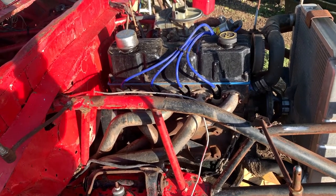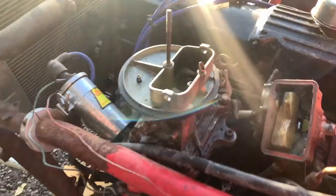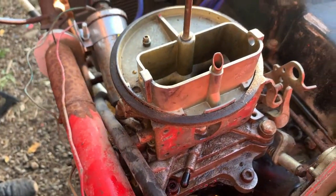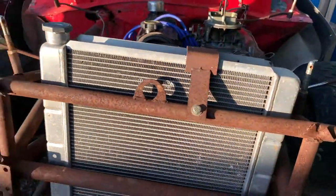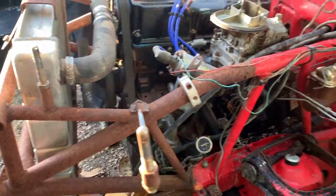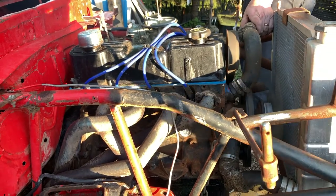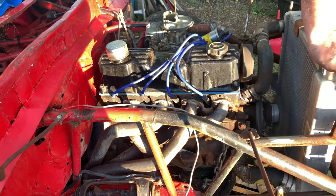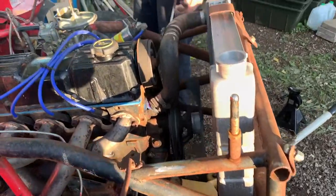I implemented the proper method to unstick it by hitting the top of the carburetor with a wrench. While I was there I took the float bowl off, cleaned everything out, cleaned up the port, made sure the jets were clean, made sure the needle and seat moved up and down, and put it all back together. A little bit of starter fluid, dumped some fuel down the carburetor, and this thing just fired right up. I had to rev it for a while to keep it running, but after a few seconds it even idled down and just ran beautifully — it made some glorious noise. I wish I had sound on the camera. Right up until it all went wrong.